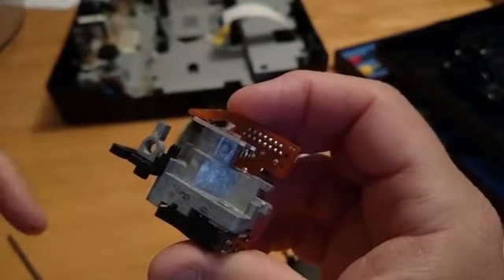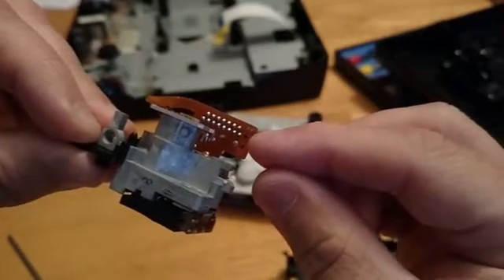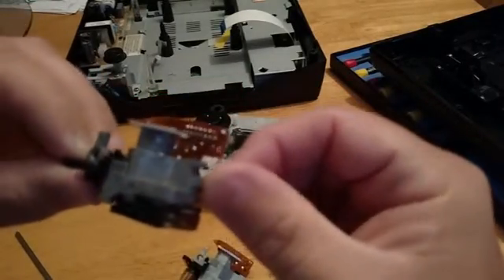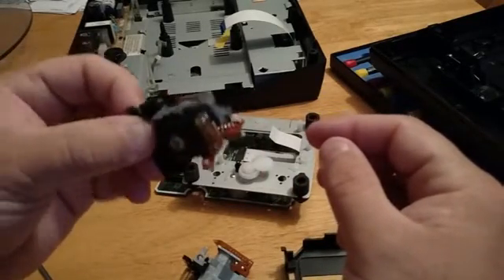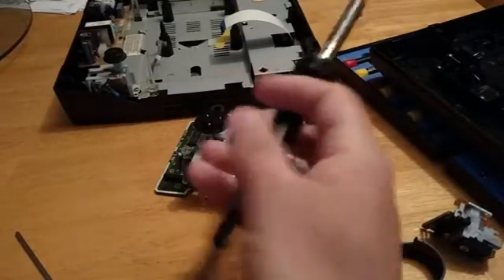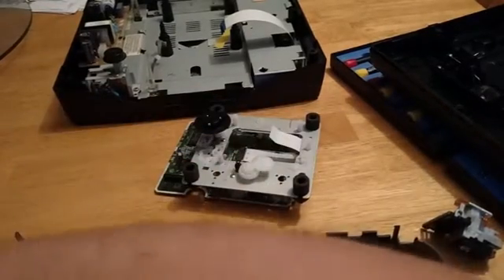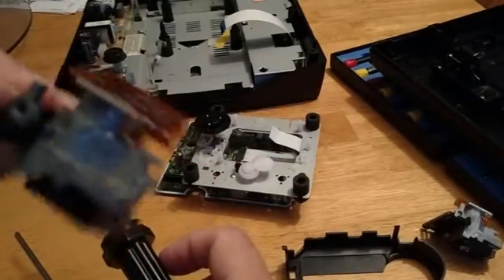Got a new laser assembly — but this is the old one I took out, it's upside down. You can see the little guide hole for the pin. There's a little spot in the corner that you don't really see. When you get the new laser, it's covered with solder. So that's the old laser — no solder. New laser — there's solder in the corner. We've got to take that out of there. Make sure you get your soldering iron hot. For those of you who are nervous about soldering — trust me, I'm terrible at it. Make sure not to get these mixed up. It really doesn't take much — just gently touch the soldering iron to that corner. And there you go, just pulled the solder off. That's it. Look — that piece of solder's gone. Don't need my soldering iron anymore. I'm gonna unplug that before I set one of my cats on fire.